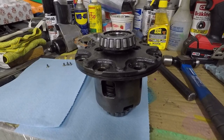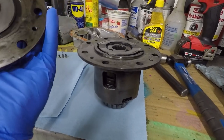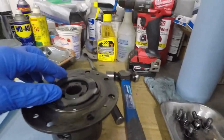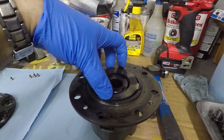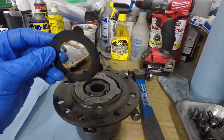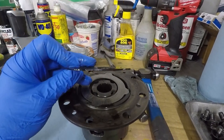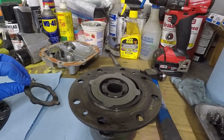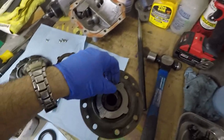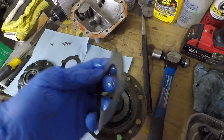At this point we'll pop off the lid and start by taking the top off here. You want to keep order to this stuff. The first friction disc at the top is the spring plate — it has a little bit of a cup to it. It's going to be very hard to see on video, but you want to make sure you're aware of which direction this goes. It's cupped up so that it puts some pressure on the clutch pack. And then from there we have the friction discs — frictions on both sides.